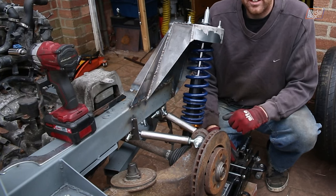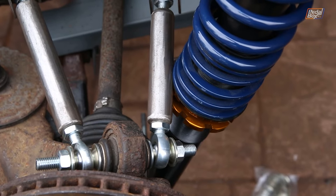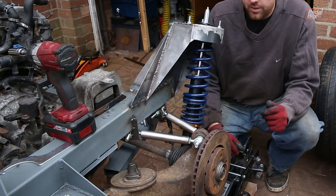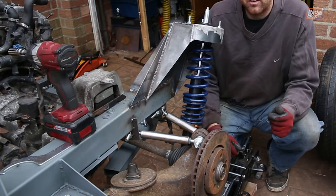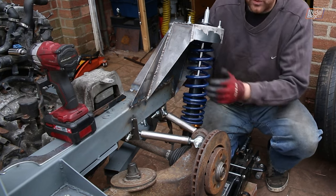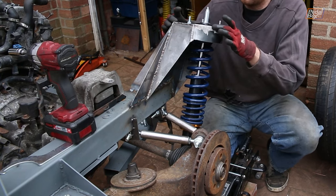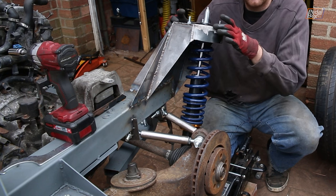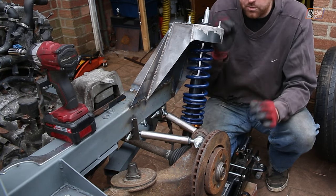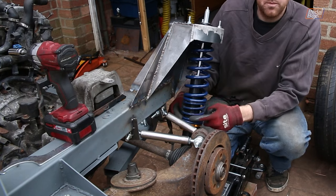We ended up creating rear suspension that had unsettable geometry, because the top pin on the hub was completely free to move — suspended between two hinge joints, and itself also being a hinge joint — so it wobbled around in free space and you could never set the tracking accurately. The shock tower is best described as an evolving design using parts we had lying around, including suspension from a Mk2 Golf and top mounts from a Subaru Forester. After three or four months of trial, welding, adjustment and errors, we had wheels that held the car up, bounced up and down, and took the original drive shafts from the diff.